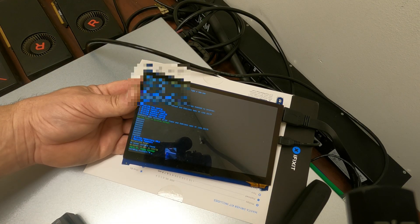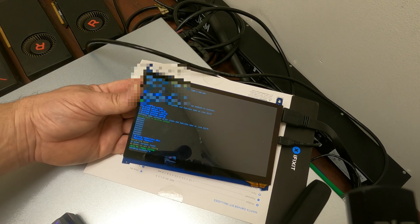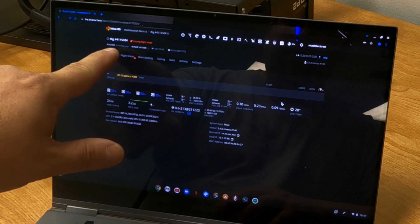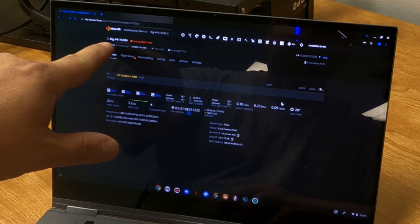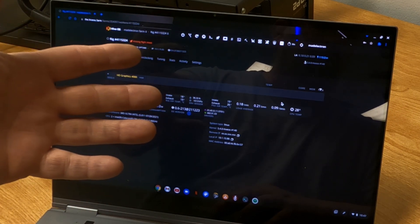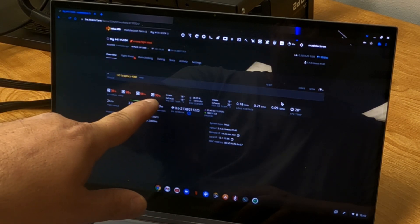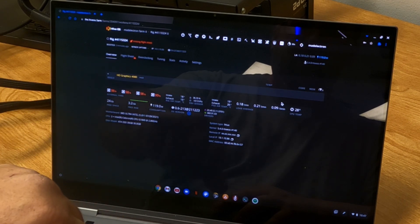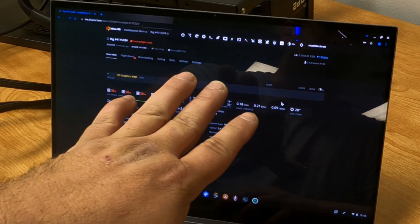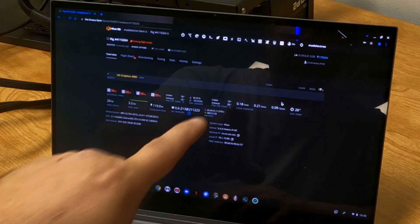Login — okay, happy mining. It already popped up and populated itself with a rig number and rig ID, which we can change. No GPU cards are showing up yet except for the HD Graphics 4000, which is the built-in iGPU for the Celeron CPU. On OctoMiner, we even get controls for those four front case fans, plus true wattage reporting directly from the unit itself — so even with AMD Vegas installed, we'll get correct power readings pulled directly from the power supplies.